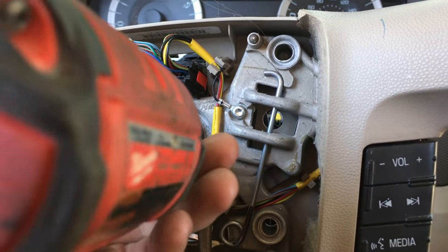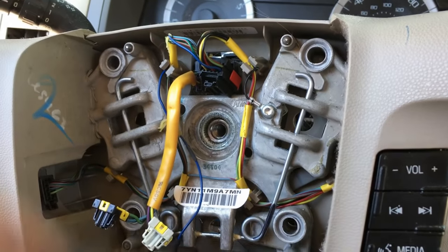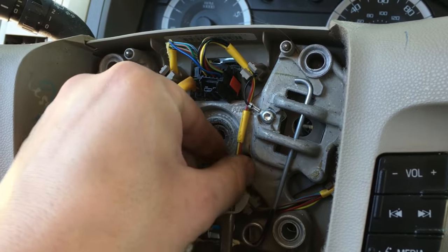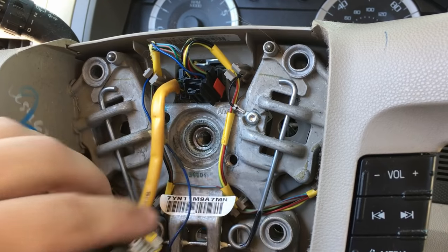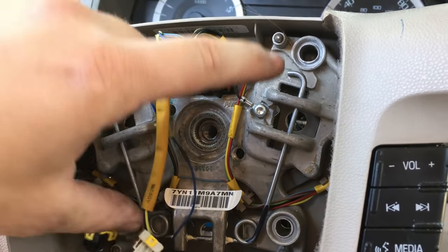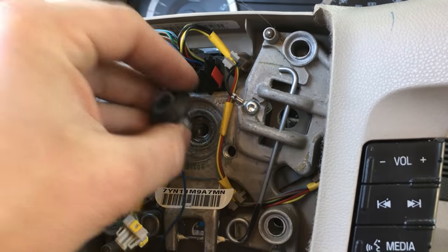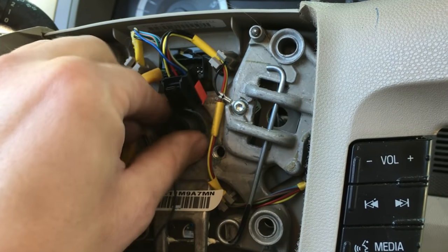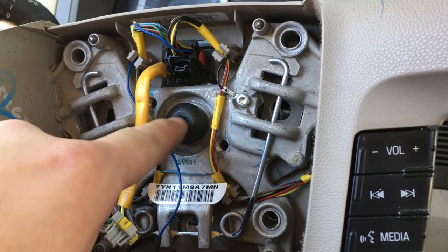The steering wheel is pressed onto the steering shaft, so we're going to use a puller to get it off. These thankfully offer holes to get a regular steering wheel puller on there. You don't want to press onto the threads, so put your bolt back on a couple of threads — it won't take much to press it off, just an initial pop and that's it.